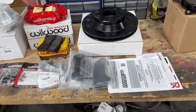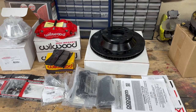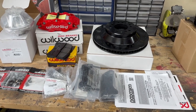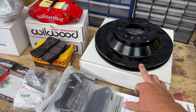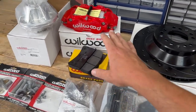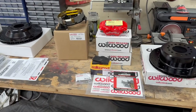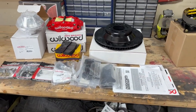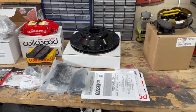My thought process on why I went with two different size rotors: I spent a little time looking, and I'm familiar with the C6 Z06 — the big brakes, the Brembos. I also had a Gen 2 CTS-V. With the 19-inch wheel combo, what I finally noticed is that even on stock form the front is about an inch bigger — so that's about matching. And if you look at the calipers on those cars, the fronts are six pistons and the rears are typically four piston. So I'm kind of going for the same brake feel as my CTS-V or my Corvette. Obviously it's not going to handle the same on everything else, but if it can brake as good, that's a win in my books.